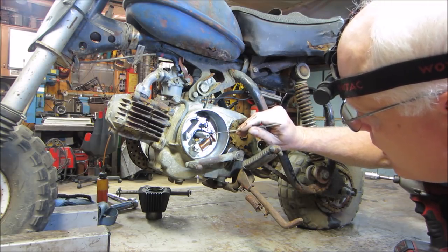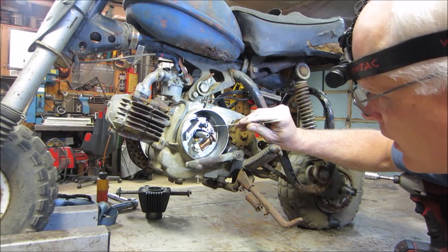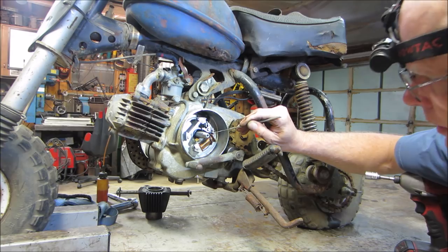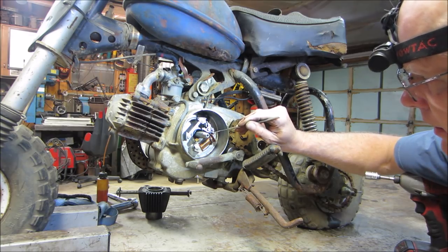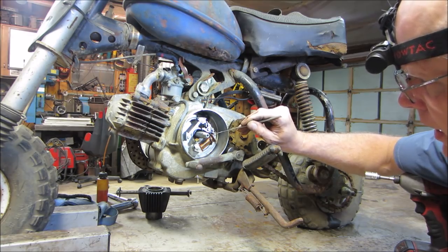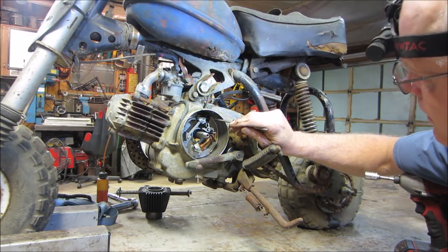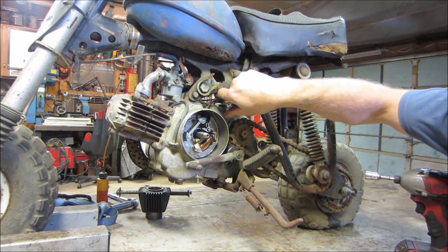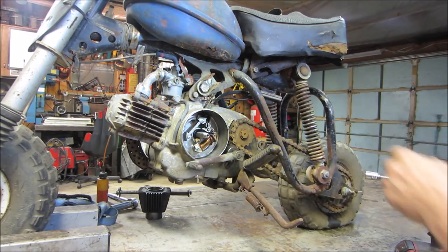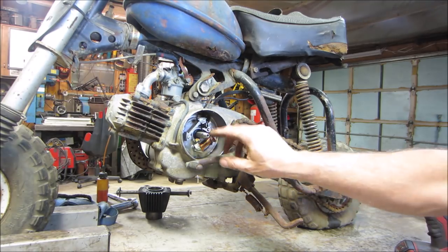This whole system has to be isolated — what I mean by that is it can't ground out to the body. Right here are two nylon-type washers, almost like a bakelite material, so that coil stays isolated down through the points. This wire should run up to the coil or key switch — probably has a kill switch — and then it runs to the coil and a condenser. Let me get that guy reconnected. Let's go clean those points and put this back together with a gap.